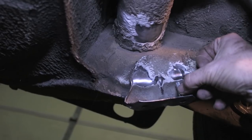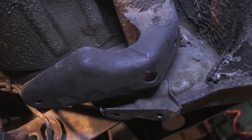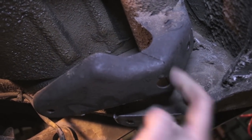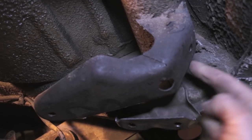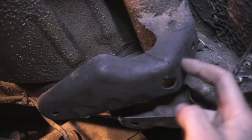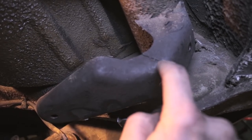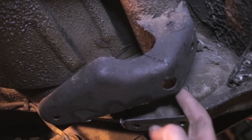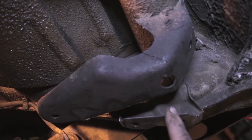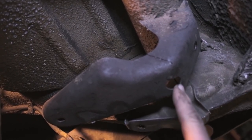On this side I did take the fuel pump out and this bracket here is pretty strong — it's already welded to the frame rail in a couple different places, so this looks okay. It does have an open seam right here, so I'll probably weld that shut on both sides just to give it a little extra strength. And then rather than going from here up to the torsion bar to be redundant, it's just going to go from here to this bracket.